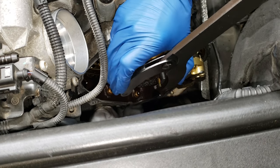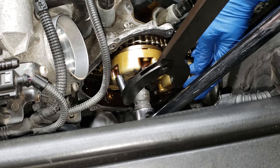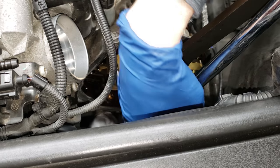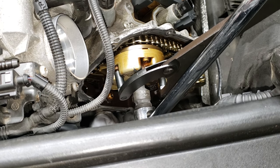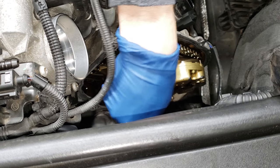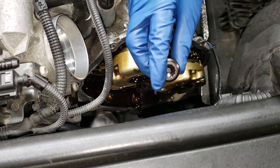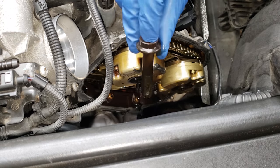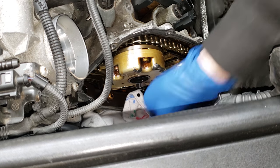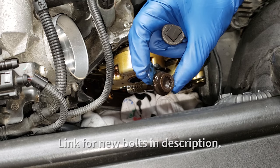This part of the tool goes inside these little grooves right here — it just helps lock in the cam so you can put extra tension on it backwards. If you use it the other way, you can see how it would open. That's why you have to reverse those pins — when you reverse the pins, then you can get this to grip. Once you get it loose, the rest should come out by hand. And that's what the triple square cam adjuster bolt looks like. Keep in mind you will actually pour oil out for a little bit too, so good to have that towel down there. You'll also want to replace these bolts 100% — do not reuse these bolts. They're not that expensive, but they do stretch out over time and they have a decent amount of torque applied to them.